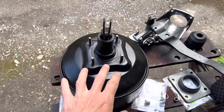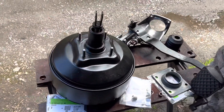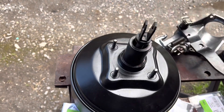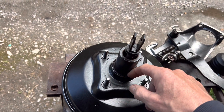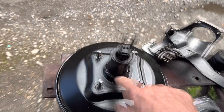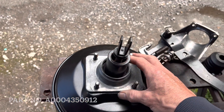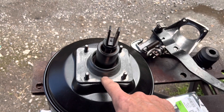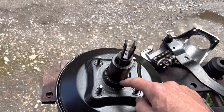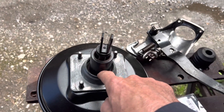When you come to put your brake booster and pedal assembly back together, there's a couple of things you should be aware of. The first one is that before you put this plate on, there should be a foam gasket in there that basically stops dirt and moisture getting inside the actual brake booster. It's missing on this car — I'll put the part number below this video clip — but the only place I can find to get that is the SL Shop and it's about £18 for a piece of foam. So we're not going to do that; we're simply going to make our own foam gasket out of a bit of sponge and pop it in there.